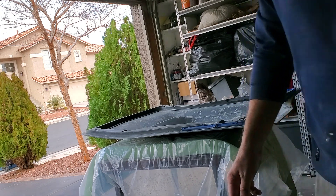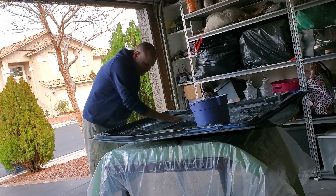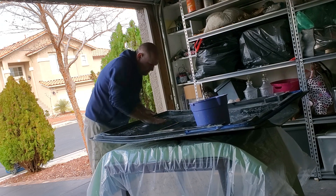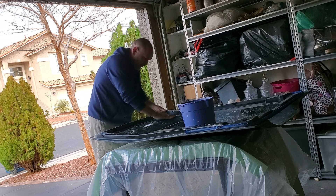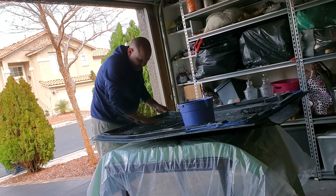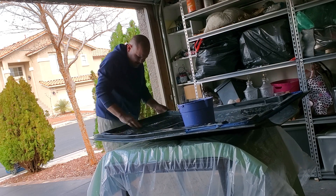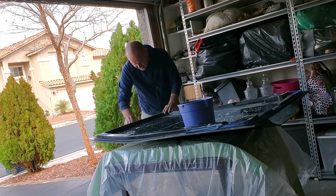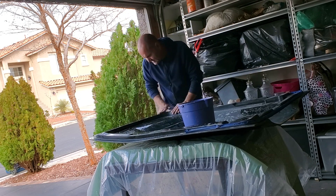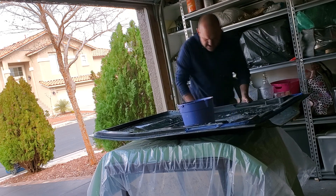I'm almost done with the back side of the hood. The reason I'm wet sanding is I can fill the grooves better if there's anything I missed — I know I can still work on that area. I mean, I'm not going for perfection here, but if something's way out of whack I can work on it. Sometimes with dry sanding you just can't see the bumps as well — when that dust is up in there, you can't see it sometimes.